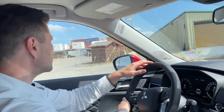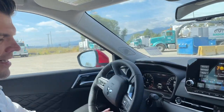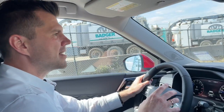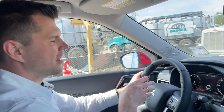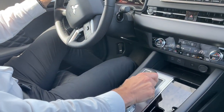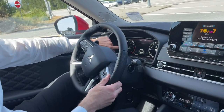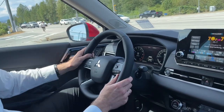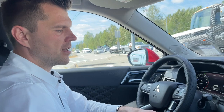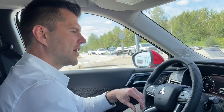What I find useful to know about this feature is that you might pull your lever by accident, and then the vehicle won't go faster than first gear and you don't know what to do. If you're in that situation, just either pull the lever one more time to return to drive, or do a one-and-a-half to two-second hold on the plus paddle and it's going to bounce back into drive. So that's a quick overview of how to operate these paddle shifters — two ways to operate them and quick ways to engage them back from manual selection to drive.